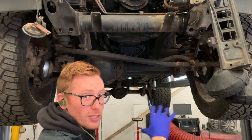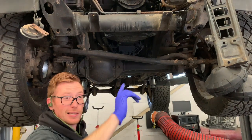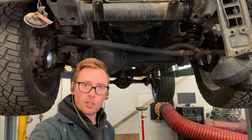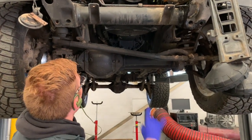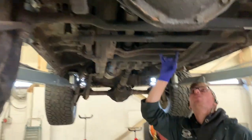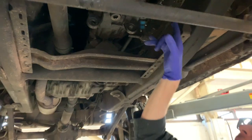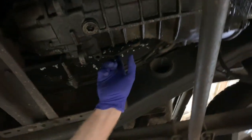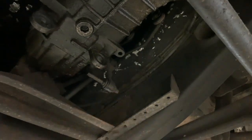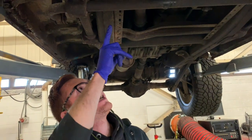Normally I take the engine and gearbox out of these cars and then take the whole thing outside, lift it right up with a forklift, and then just literally steam clean the lot, blast the old rust off it, everything, and then bring it back into the workshop and dry it all out. So yeah, we're going to take the engine mount bolts out, we're going to take the gearbox mount bolts out, we're going to take off the gearbox stabilizer, which connects the gearbox to the transfer case. The linkages, I'm going to take the three linkages off, they're going to be disregarded anyway, so take them off any way you want. And also while I'm down here, I'm going to take off the exhaust.